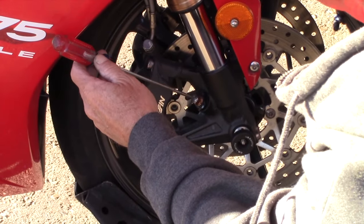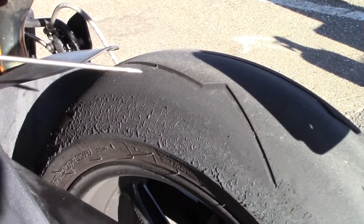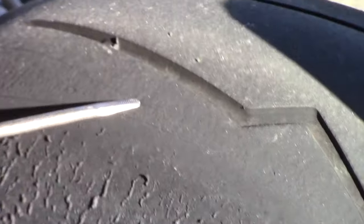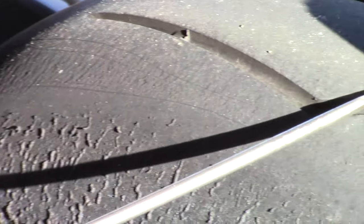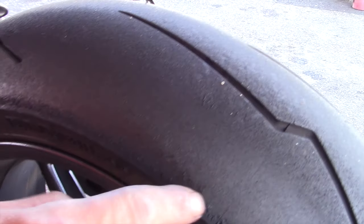So low speed was at 16. In effect, that's not working. If you look at the tire, there's an evolving tear, right? And it starts as a thin point, and it works its way all the way back, and it gets thicker and it gets deeper. So when you look at what's going on at the tread, this edge is nice and sharp. This edge is all chamfered off and it's rough. So the only thing that concerns me is the outside here — there's lots of spots. All the little beads that are on there, all these little gray darts that are all over the place, and this wear here.